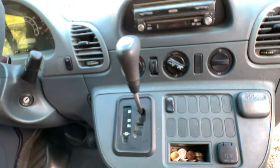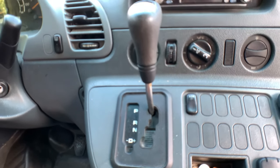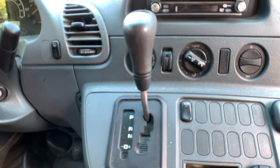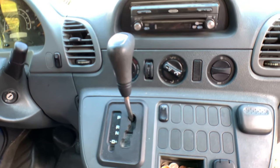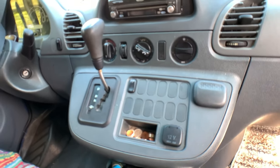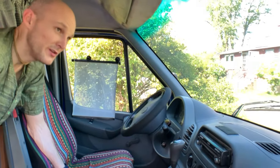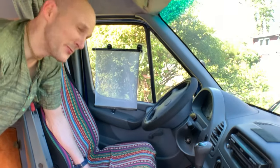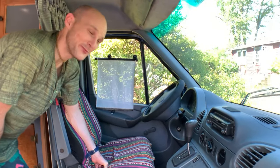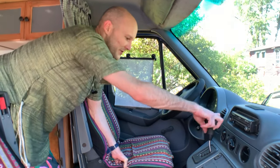The transmission has selectable gears — five gears total. When going downhill you can downshift all the way to first. I don't like to use it too much to avoid strain on the transmission, but it does help on steep roads. I'm a Florida guy so I hadn't seen many steep grades, but we've followed the beach up here. If you need to, especially coming down, throwing it in second or first really helps you get that grip.